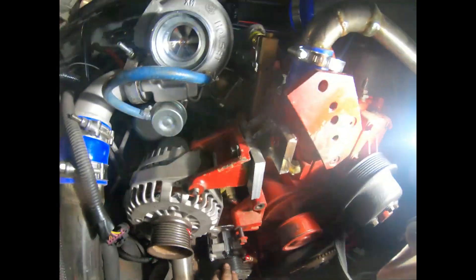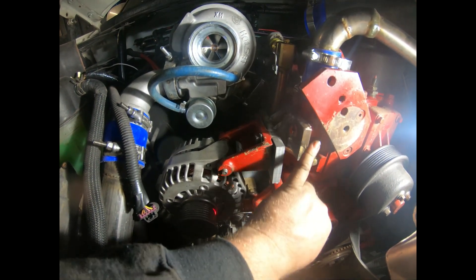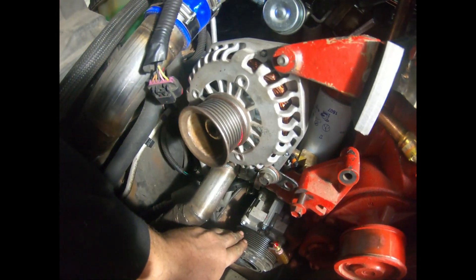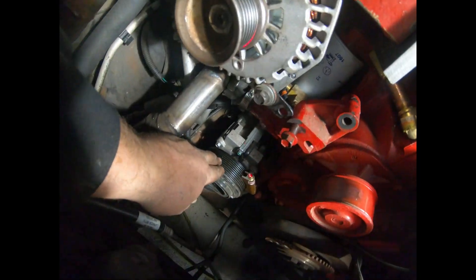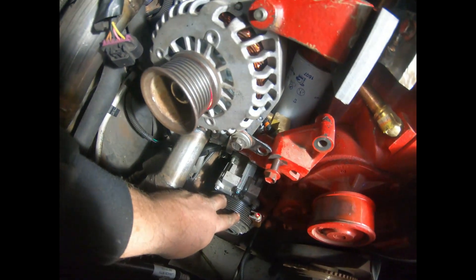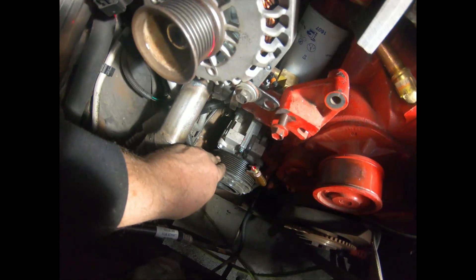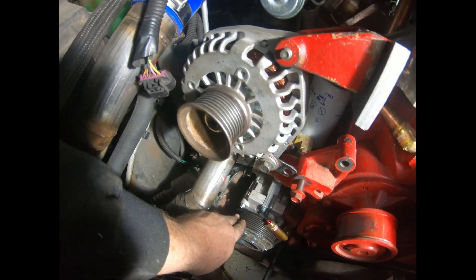Now let's get that alternator bracket off and get that machined out again. The mount is fabbed up — I'm going to take the mill and go over all the edges to clean them up. We are lined up now. I still have to do the bottom mount, but the most important part is done — I just need to make a piece from this bolt over to that bolt. The pulley is lining up now; it's not sitting crooked. You can see on the alternator pulley when I move the laser it stays right in line with where it should be.